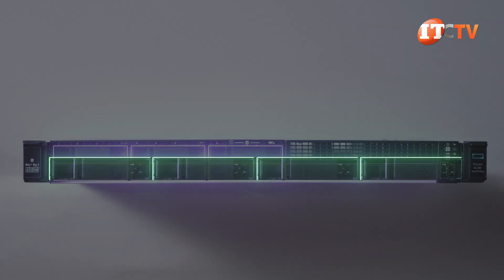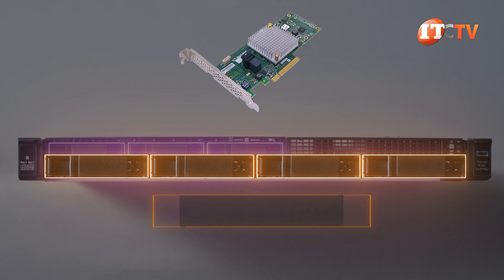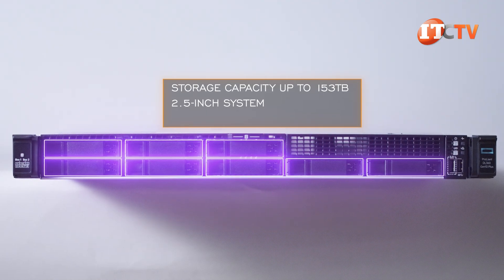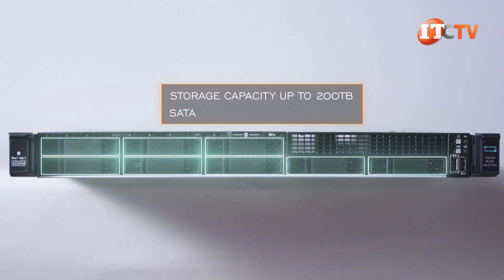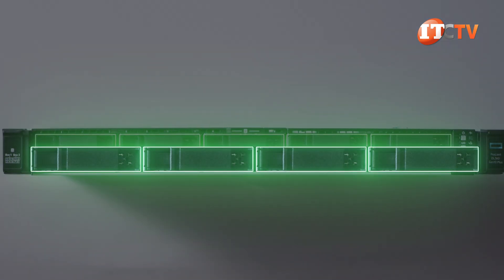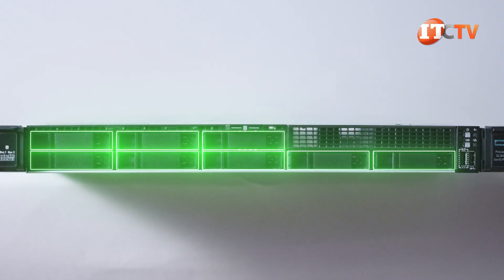There's also an option for two more drives through the optional media bay. The 3.5-inch chassis is listed as just SATA or SAS drives, and only has a single backplane associated with that configuration. You will need an HD RAID controller for SAS drive formats. A maximum storage capacity of up to 153 terabytes on a 2.5-inch system is possible using SAS or NVMe drive types, but you could get up to 200 terabytes with a SATA implementation — incorporating two additional drives in the media bay for a total of ten up front. In general, you get significantly less storage with a 3.5-inch bay chassis. For both, an optical drive is optional. Our chassis doesn't have the optical drive bay, nor do we have an optional drive cage.